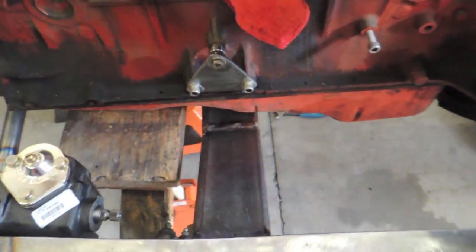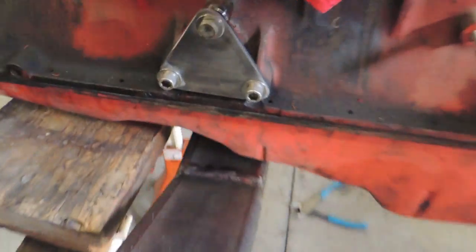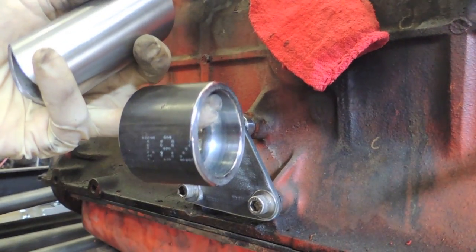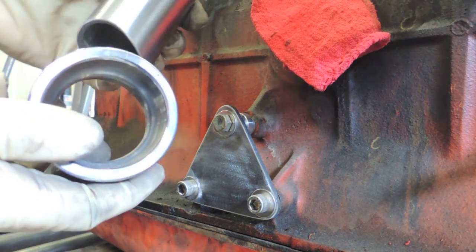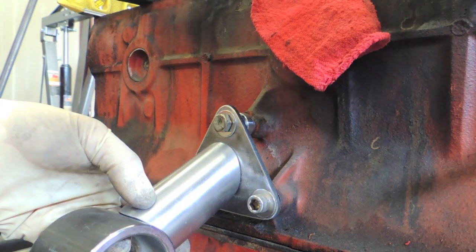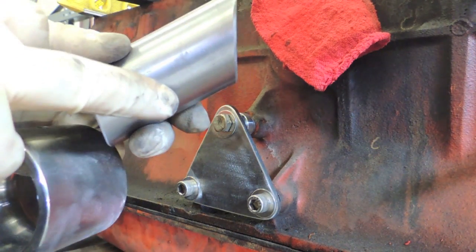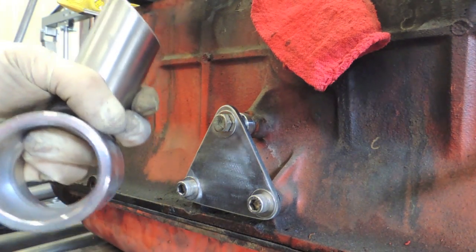Alright, so back at it on Kevin's car today. Let me show you what I got going on and what I got done yesterday. Got the engine crossmember welded in, got the motor leveled out, got the chassis leveled, and also made these engine mount plates. The plan with these is — I got these bushings from Four Wheel Parts, so a bushing goes in it and then a sleeve, and then I'm gonna weld tabs down on the crossmember that are gonna have a bolt passing through this. And then I got this guy coped to fit — pretty nice cope — and that's gonna weld on here. It's gonna be pretty sweet, gonna be super stout. This is probably chromoly and this is DOM, and that's just mild steel because that's not super important. It's gonna look badass — I'll TIG weld it up. I'll do a little time-lapse of TIG welding that for you and then install.